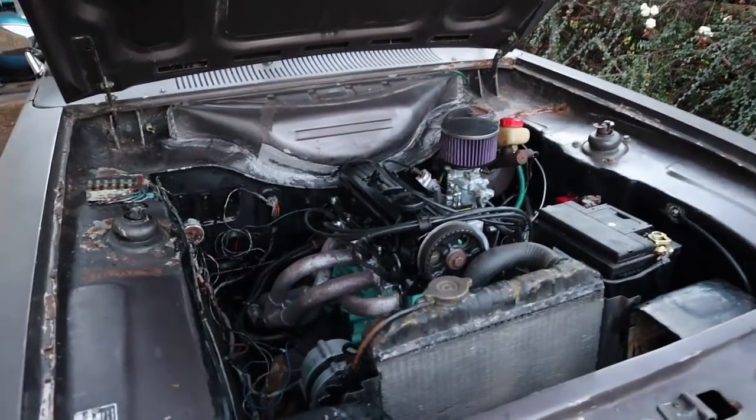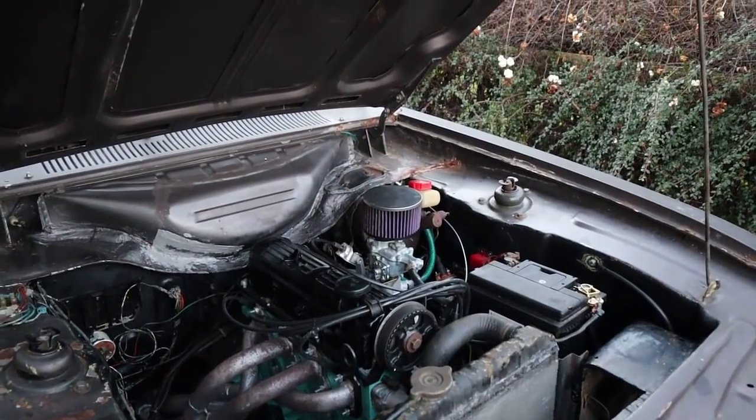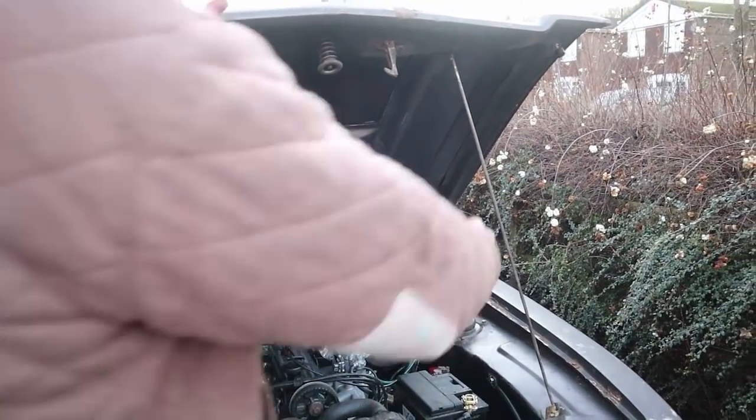Right, dude. Carburetor had a 50 jet. And we were having stuttering. Right? Correct. It wasn't enough. Felt like it was enough. Too much air, not enough fuel. We've got 55 in there now. Okay, so we've got a bit more fuel. Yes. So it should equal out.